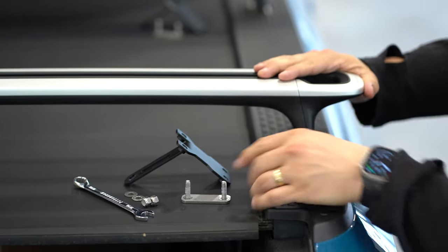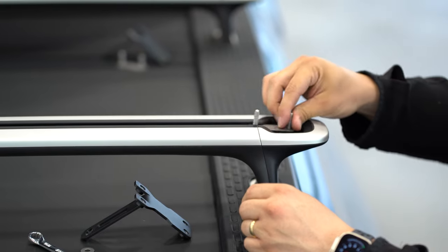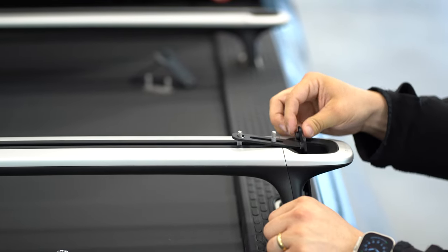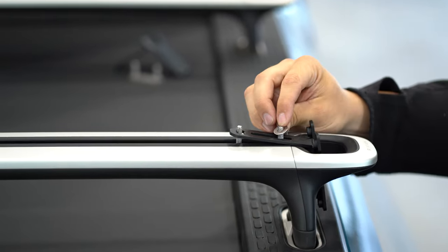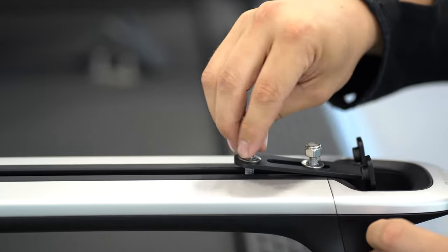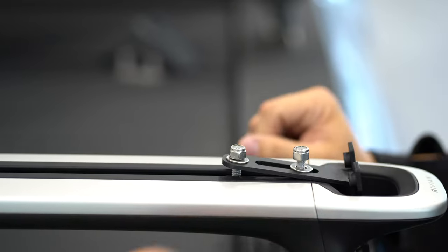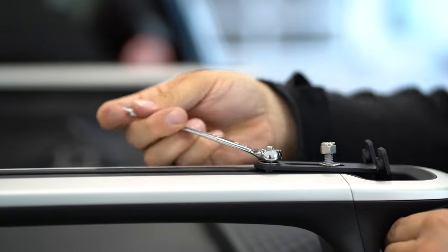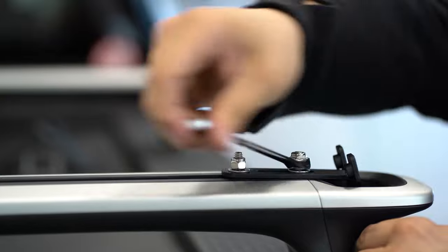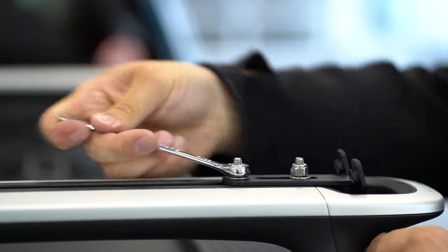So the first step, once you've got your OEM crossbars installed, is to take the track stud here — that's a stainless piece of 10-gauge steel with two studs pressed in — and slip that into the track. Then we'll take our support bracket down through the opening in the crossbar and over the track stud, just like that. Next, we'll take one of our stainless washers and one of the stainless nuts and get that started. Do the same thing with the other end. After we've got these started — careful not to cross thread these — I'm going to tighten these up so that I can still slide this around but they're just close to being snug. That step is just a little bit easier when you don't have a panel on the way, so whether you're spinning a wrench or a socket on a ratchet, you're going to save some time and headache doing it like this.